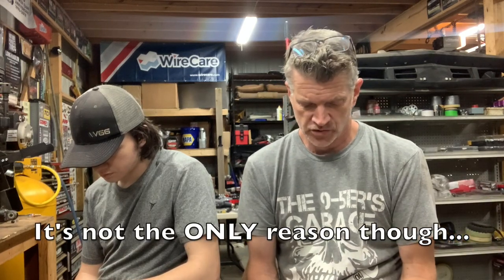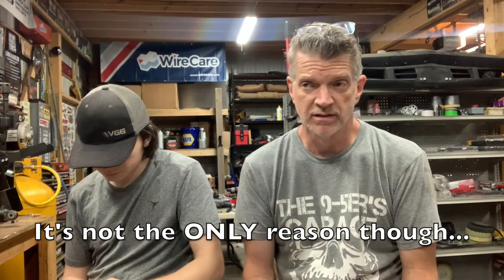Every part number has a particular flow, a shutoff time, a turn on time, a lot of parameters for each. Well, we couldn't find ours, so we guessed with what we thought was a good part number that might work as a replacement for it. Well, that's why the car is running like crap. So when I talked to Holley, they said, nope, absolutely cannot substitute a number. You have to have the right part number.